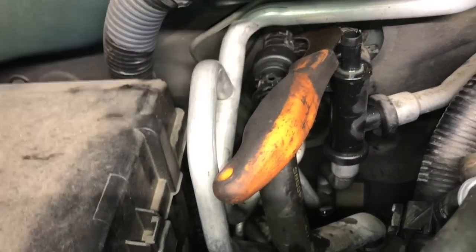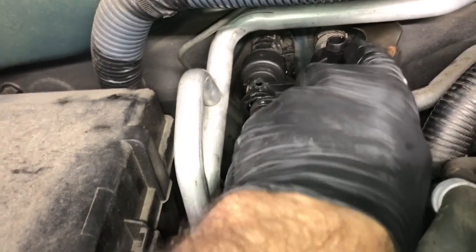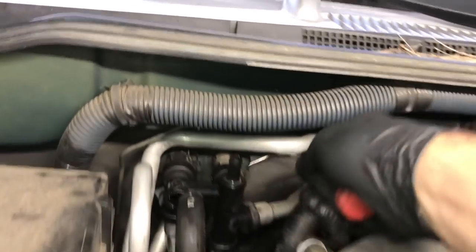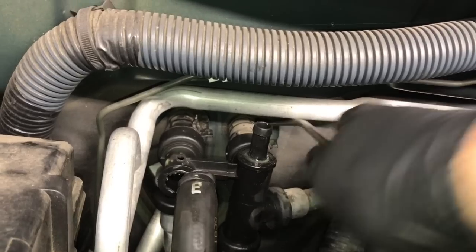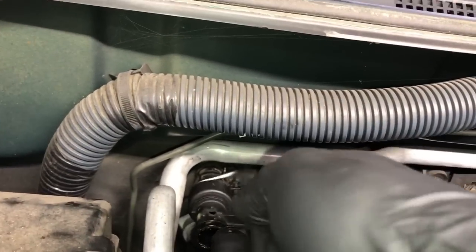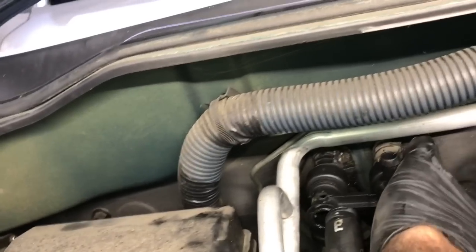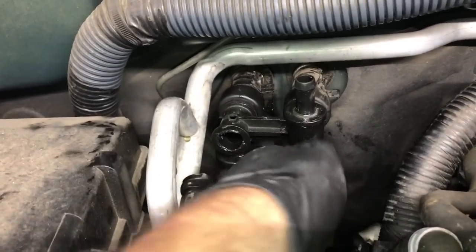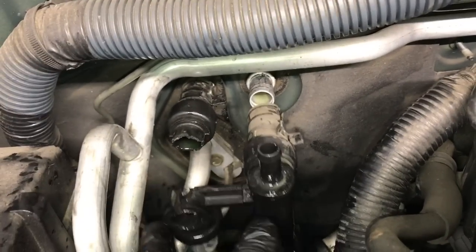As I was trying to do this the whole thing is just falling apart and turning brittle. Now that we've got the clamps back, I'm using a knife and making little incisions on the hoses. Then I'm going to use a pick tool or screwdriver to flare the hoses open a little bit and pick behind them — that'll help free them up to get them off the pipes. They like to adhere and get stuck, so loosen up the hoses on the pipes, run the pick around a few times, and then you'll be able to pull them off. Most likely they're going to crumble and break into pieces as you pull them out — that's perfectly normal, that's why they need to be replaced.